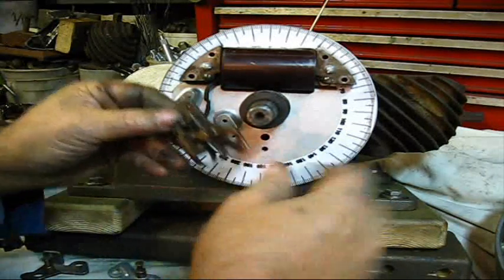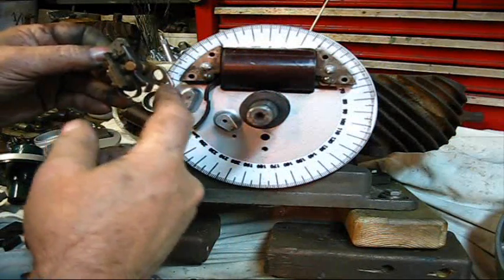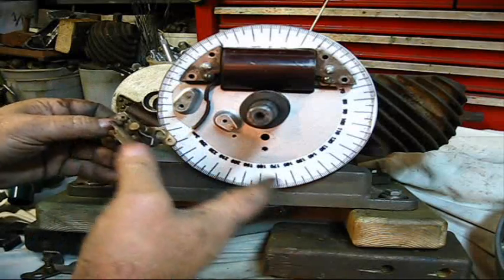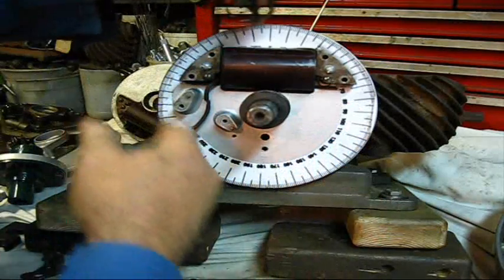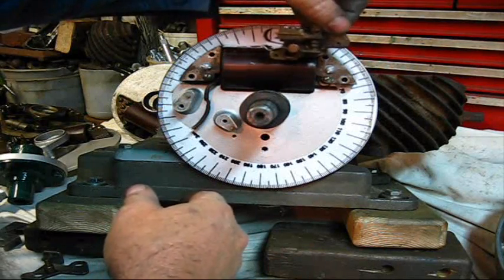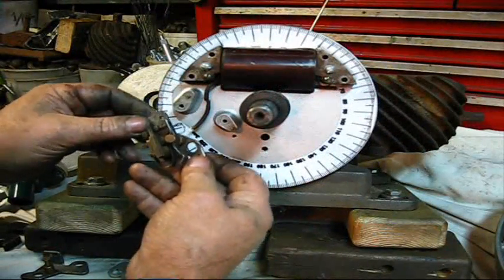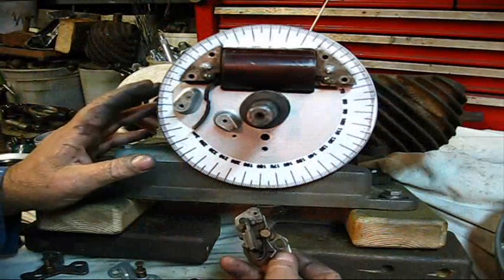Once you accomplish that, then along that arc — along that circle — you can position this point blade at any position along that circle. So you can go from, let's say, 20 degrees before top dead center, and by rotating this you could get to 20 degrees past top dead center. That's the only caution to keep in mind when imagining what's happening inside this backing plate.